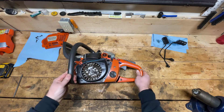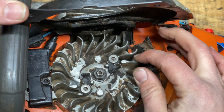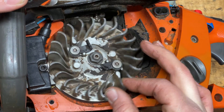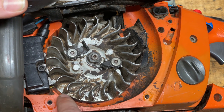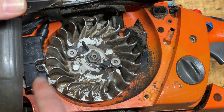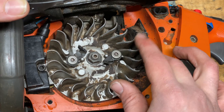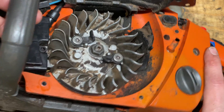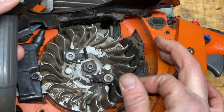Let's pop this cover off and get out the coil. What we're looking at here — I'll zoom in — this coil is contacting. There we go. We've diagnosed the rattle. This is a magnetic field right here, created between the coil and the flywheel. Every time this spins around, it sends a charge through the coil, which then goes up into the spark plug and creates a spark. If you don't set this properly — that's the magnetic part — it hits up against the coil.